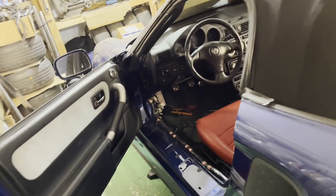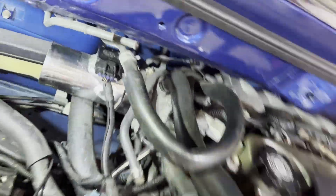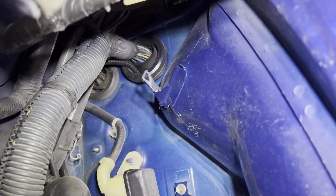Now that I got that power harness for the gauge installed, it looks good enough in there — that'll work just fine. Now it is time to take the sensor harness and fish that from the engine bay into the cabin. This should be relatively easy because I've already fished some wires in through there. You can see my wires going in through the grommet — those are actually the wires I had to add for the 2ZZ swap to control the lift solenoid. Basically what I can do is just poke a hole through the grommet outside of the main harness and fish it right through there, then find a good spot to run it out to where the wideband sensor is going to be.